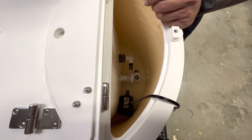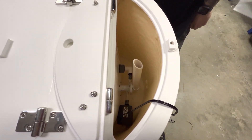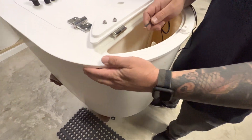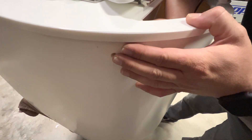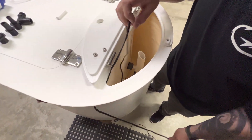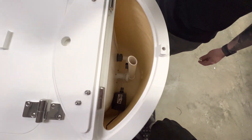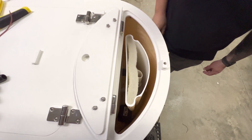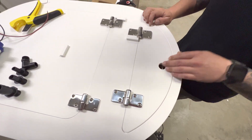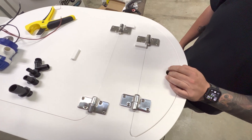That's how you put the new pump in. Put your standpipe back in — it just pushes in; twist it and make sure it's straight. Grab the wiring and run it through the hole on the side of the bait tank. Find the hole inside with the wires, push them through, and guide it from the inside while pulling from the outside. Then put your filter box back in — it slides right down — and you're done. If you have any more questions, reach out to Andy on Facebook or his phone number is on the website. Thanks guys, we appreciate you.